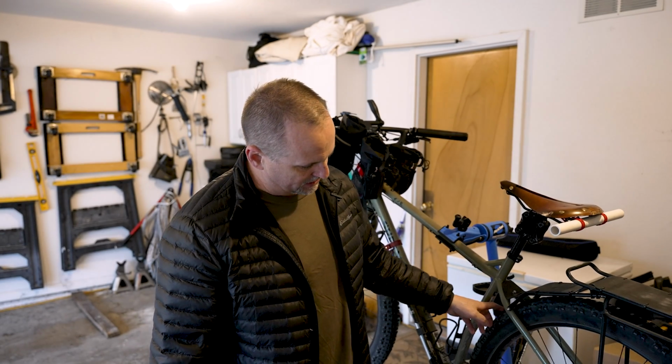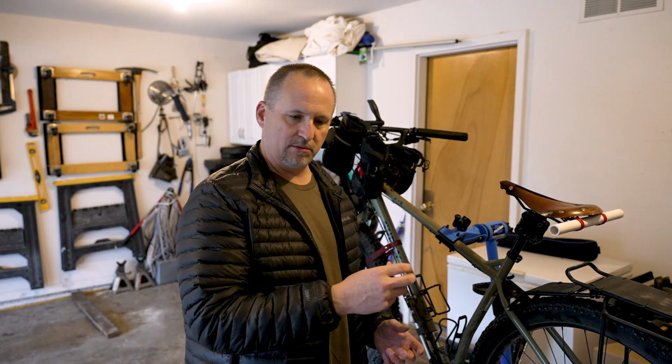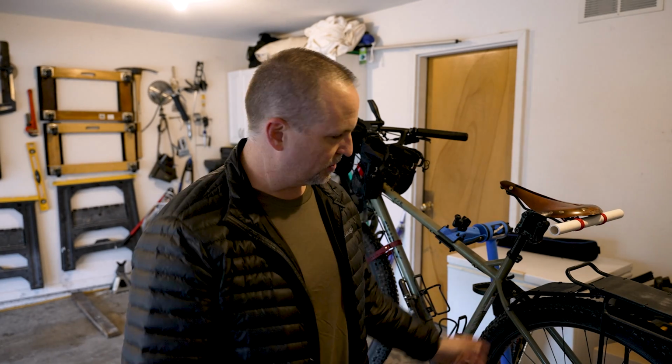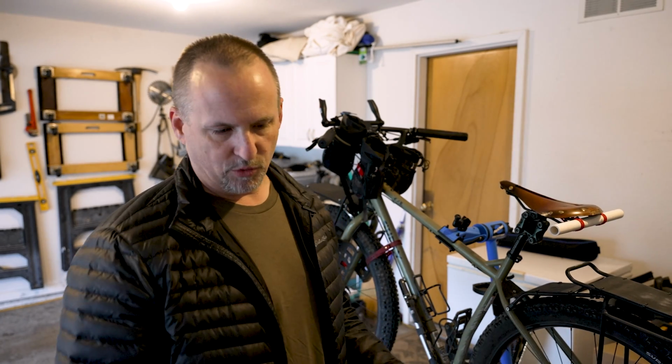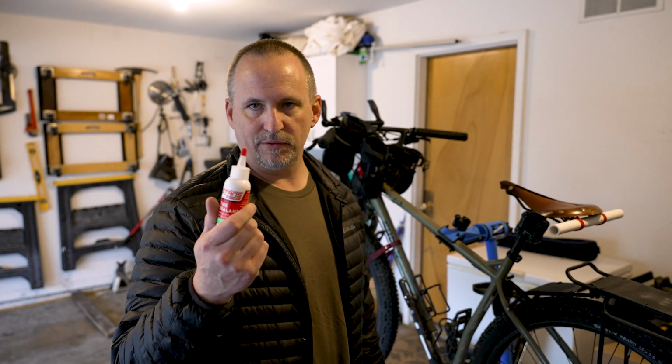The way you do it is basically just have your tire kind of down on the lower end, take out that valve core, squeeze in some sealant, put the valve core back in, air it back up, you should be good to go. Spin that tire around. If you're like me, I never realized that I need to really be checking this routinely and found that that was one of those things that was definitely necessary to make sure that my tubeless setup was working efficiently and effectively all the time. I also really do recommend carrying 1 or 2 of these with you all the time.